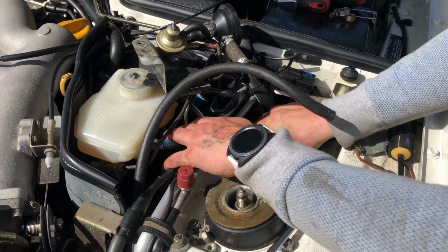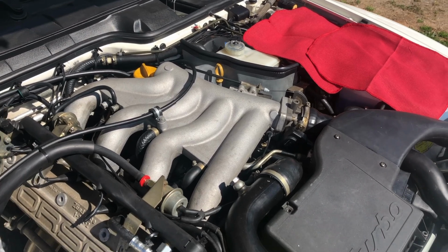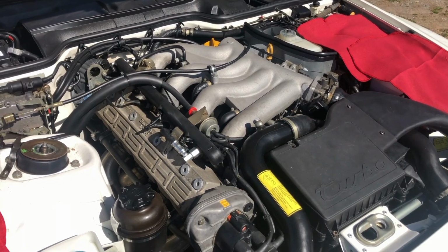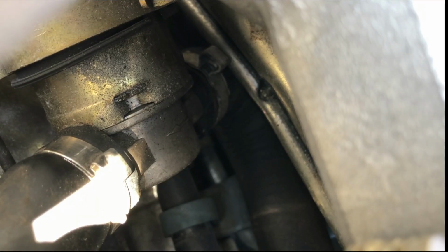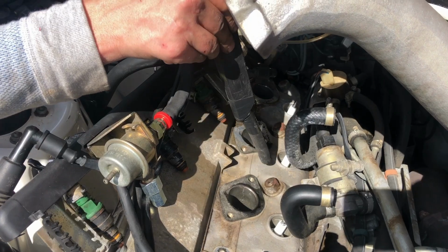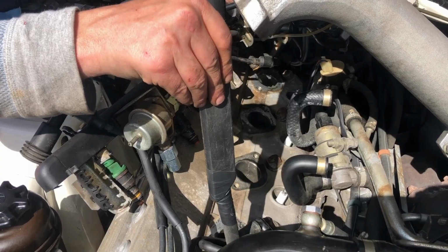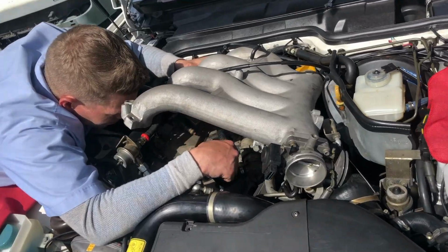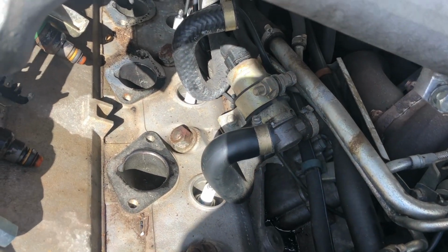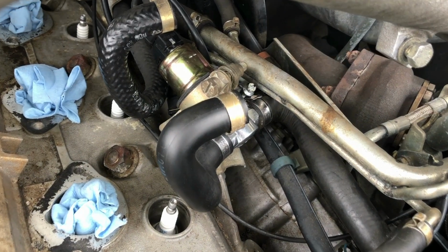Alright, they've got the clutch master cylinder out now. Alright, the new clutch cylinders are in, so today they're going to remove this intake so we can check that boost leak. So we have the intake off now, and it appears that our leak is from the idle stabilizer valve. The new idle stabilizer arrived and we've already got it in.